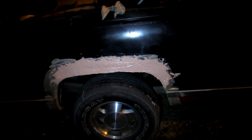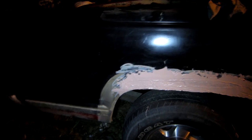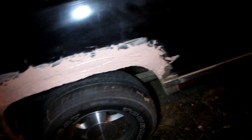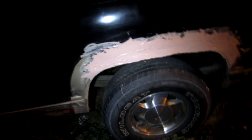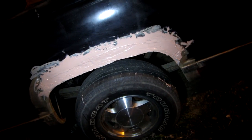Finished welding the seam and went ahead and put filler on it. I don't think that filler is what it was advertised as, because it just ain't right. I haven't done any sanding yet — I just finished the second coat of filler, trying to get it to shape like the fender on the original trucks. That actually came out really, really well.